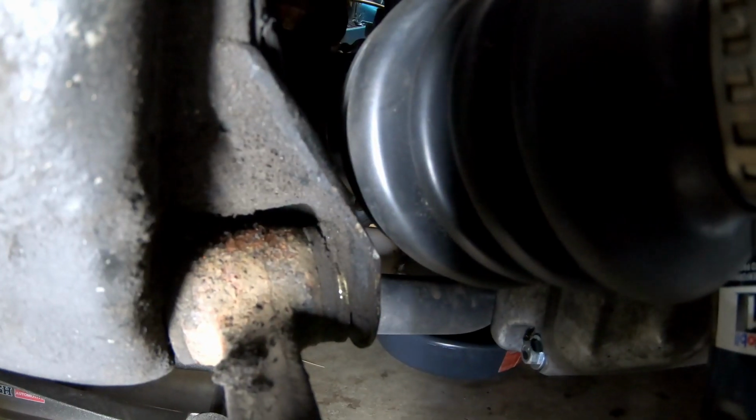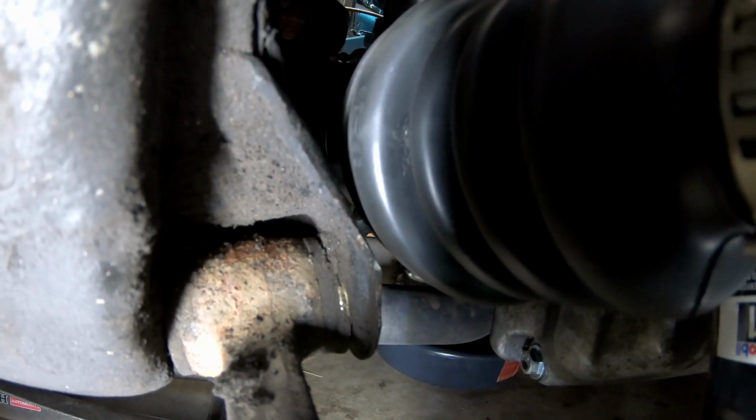I've been sitting here for like the last 20 minutes, not really sure the best approach of what to do. So the axle did go in place like it was supposed to. My concern is that at the closest point, I only have like 1 millimeter or 2 of clearance. I thought about just hammering out the subframe a little bit, but I'm nervous because of how close I'll be hammering to the lower control arm mounting point, and I don't want to mess up the suspension geometry. My plan is I'll do the other side and then I'll kind of just sleep on it and go from there.